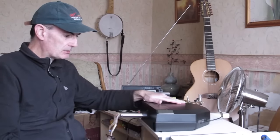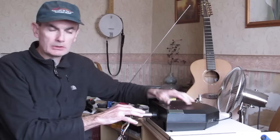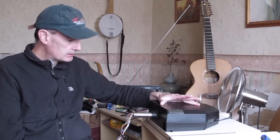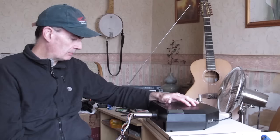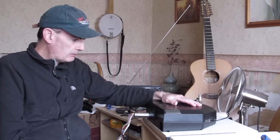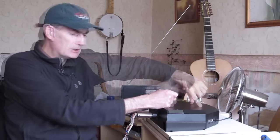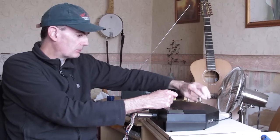Now, there's a lot of travel in this, we're not going to need this much travel. The standard travel of this yoke is about 3.5 inches, if I remember rightly. So we only want to use 3.5 inches of that sliding action. In fact, when we look at how to attach our push rod to the end of that crank, the crank that connects to the potentiometer, it's actually obstructed by a piece of the structure. So we might lengthen that slightly.